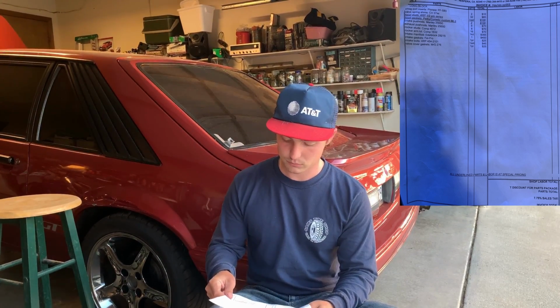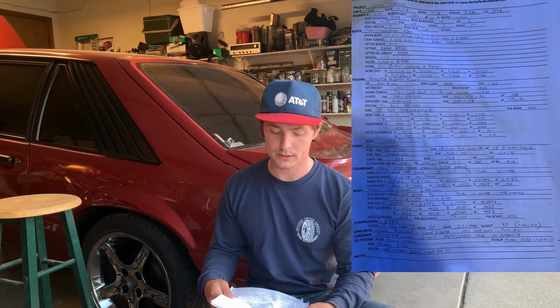I wish I would have got the Holley elbow because it has vacuum ports on it, so what I have to do is run a spacer with a vacuum port, and then I have to put my IAC into it too if I want it. I should have gone with the Holley elbow instead of the Edelbrock elbow. I think Holley just made a better deal with that. So, alright, we'll go to the next page. Oh, and also, with that elbow, I'm running an AccuFab 90mm throttle body. We want all the air, right?